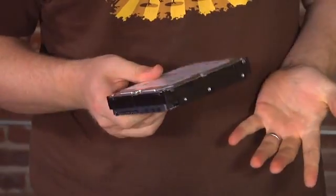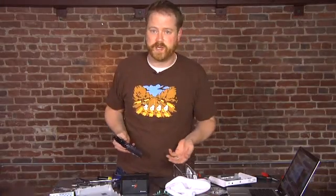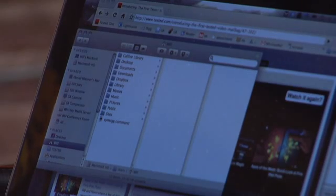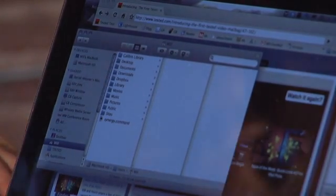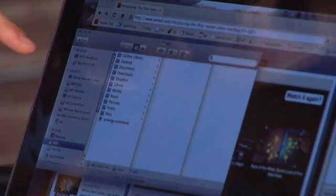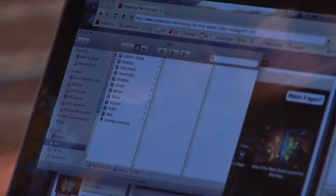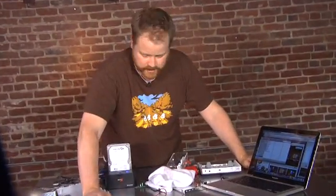And I have in my left hand a 1.5 terabyte Seagate 7200.11 — a 7200 RPM hard drive. Next we're going to jam it into this USB hard drive dock, connected to my MacBook Pro. I believe this was Andy's Time Machine backup disk, so we'll see how this works. We're booting it up, firing it up right now — I hear it spinning. And if it all goes well, it should pop up right there underneath Macintosh HD, which I suppose stands for hard drive, not high definition. And there it is — voila, ladies and gentlemen — backup. This was Andy's Time Machine backup disk, so he should be able to restore all of his stuff from whatever happens to the machine in the future. So this was how to free your hard drive from a hard drive dock. I'm Will Smith — we'll be back later with more awesome stuff. Thanks for watching.